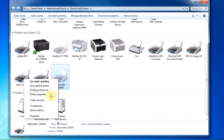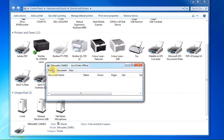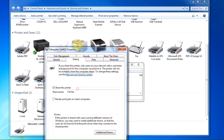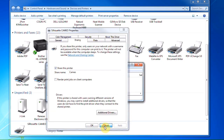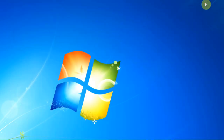Assuming you have that, you can just right-click on it and get to printer properties. Eventually you get to a window with an option to share the printer. The share name I just gave it is Cameo — you can do anything you want. We'll use the Windows print sharing to actually communicate with the printer itself. After that's done, you can close it all out.